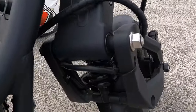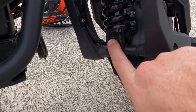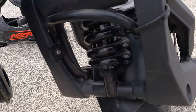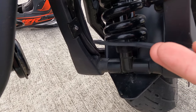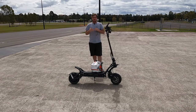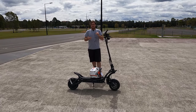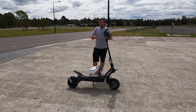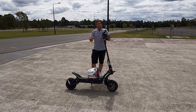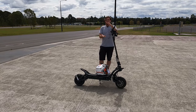As you can see, we've got an adjustment ring collar on the bottom of the suspension which the tool actually interlocks into, as shown in the clip here. The red knob is just to adjust your dampening. Dampening basically controls how the suspension behaves - at its softest it acts like a trampoline.